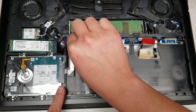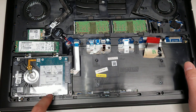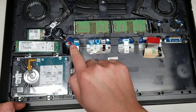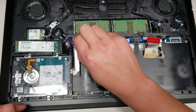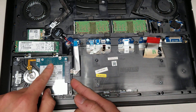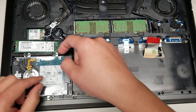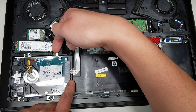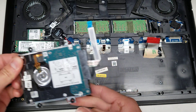After you get the battery out, you'll want to remove the hard drive. There'll be four screws holding it — two here and two here. The rubber things might make it a little stuck, so you're going to have to try and pull it. Basically, you flip this little white tab up, then grab the blue part, and kind of just pull that. After you get the four screws out, you can pull the hard drive up. If it's stuck, be careful — pry from the metal piece, not from here, because you can break the connector off.